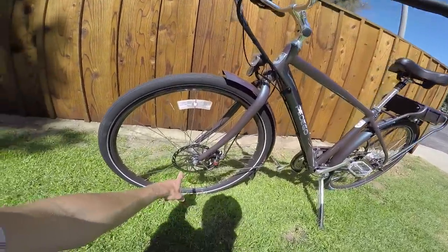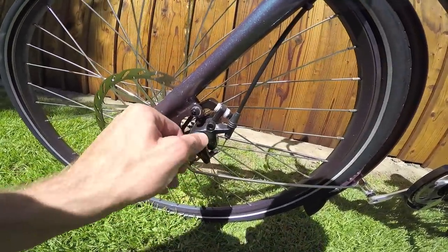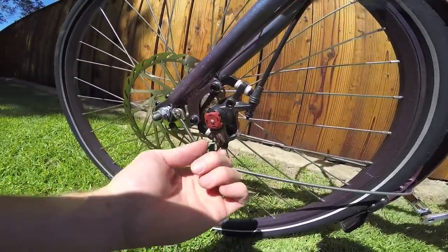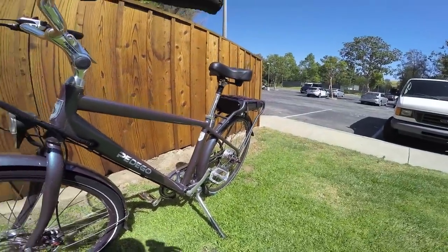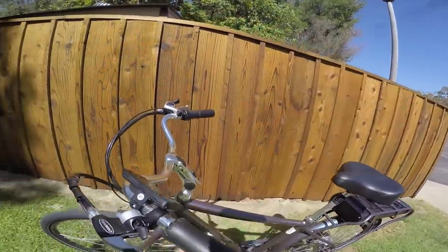Again, 180-millimeter mechanical disc brakes — they've even got these little red twisters so you can adjust them manually by hand, or use a little hex wrench and service it yourself, which is a little bit easier than if these were hydraulic. In my experience they stop really well and don't require too much extra effort to operate.